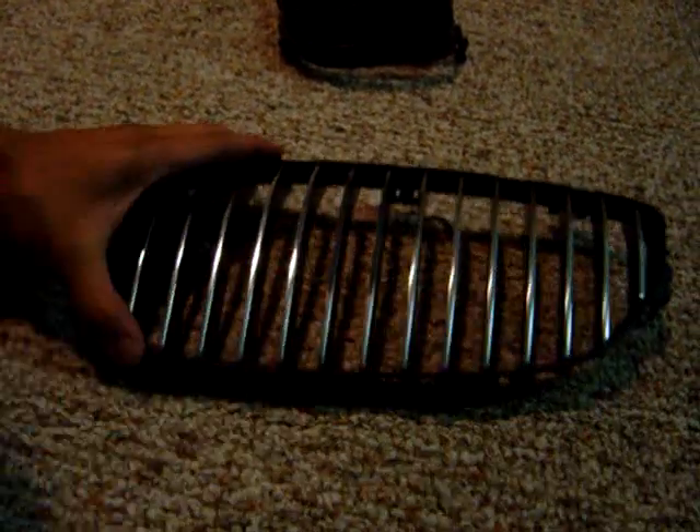I've got my 220 grit here, and all I do is literally — watch, as you can see it's all shining — watch. It's gone already, you see that? I'll do this — see how these are shining right here? Now watch. Gone. Now after you do it like that, do it diagonally like this, because the edges right here are going to shine. So not only like this — make sure you do it like that, and then like that, and then spend a lot of time on the top. You're not going to get all of it, but try your best.